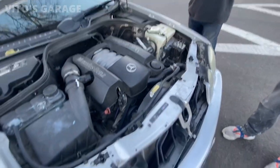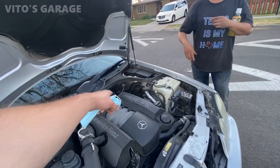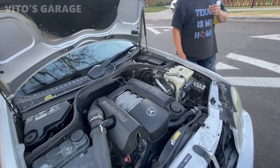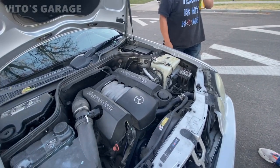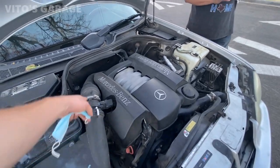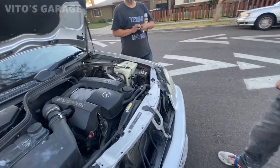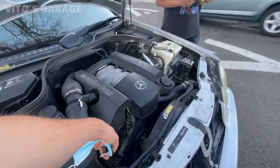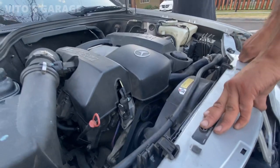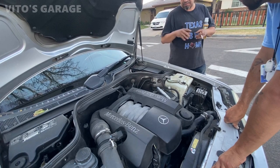There was a crank sensor — it was underneath something and really hard to get to. The crank sensor is all the way in the back, with one bolt holding it and the connector. Another thing with these engines is oil leaks, mainly the valve cover gaskets. They start leaking and you'll notice a burning oil smell inside the car — oil drips on the exhaust manifold and burns right there. Yours looks fine for now; maybe somebody already replaced it. You can avoid that issue by re-torquing them periodically.